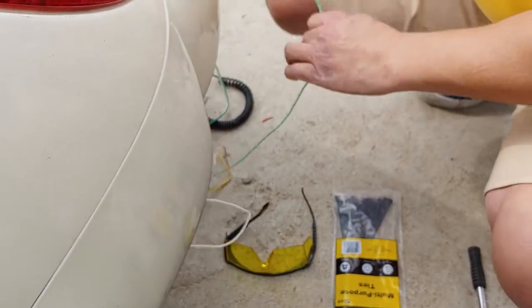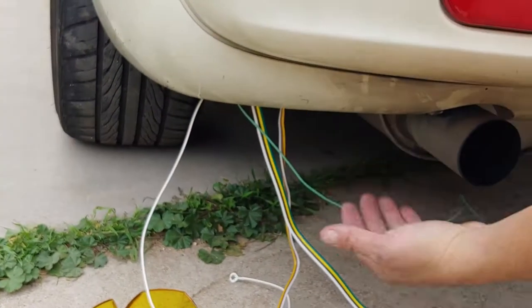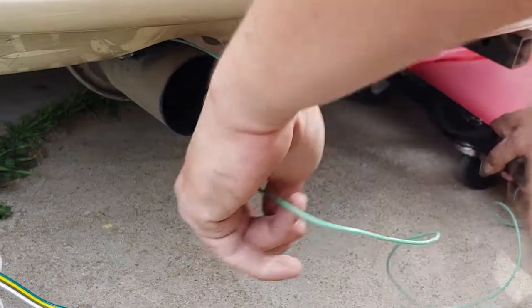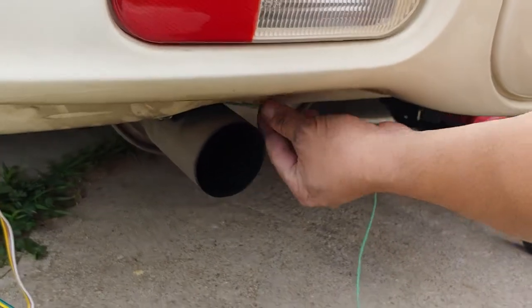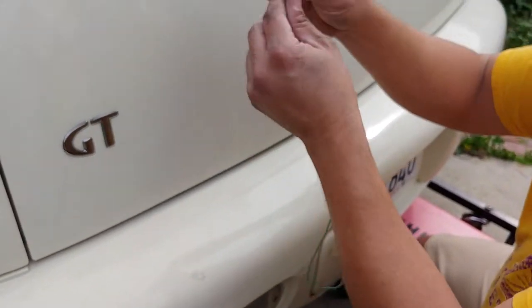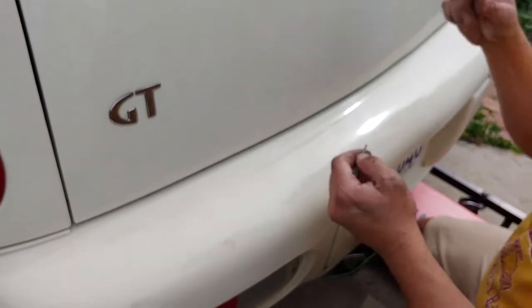This part is going to go all the way across. What I'm going to do is real simple — I'm just going to go ahead and hide it underneath. The muffler's in the way, so you've got to tuck it real nice underneath. Follow that over this muffler section, bring it around, and then go underneath. I'm going to use my creeper — you can use a cardboard, a towel, whatever you want, or even bare floor. Run this in, hide it, and this is going to come around. If this green wire is kind of short to make its way up, I'll just take another piece of green, splice it, make a good connection, and extend it however long I need it.